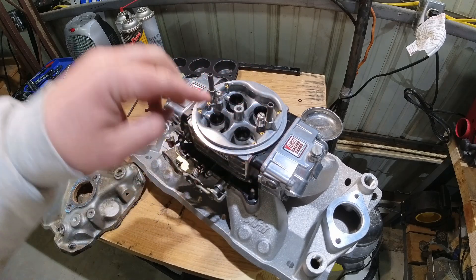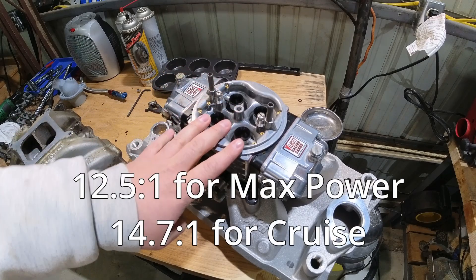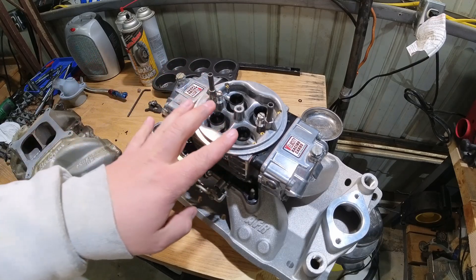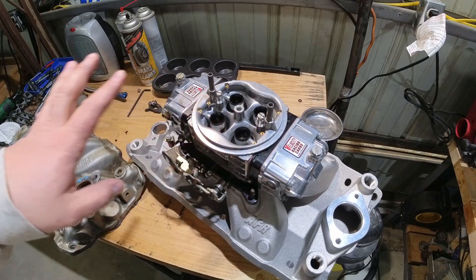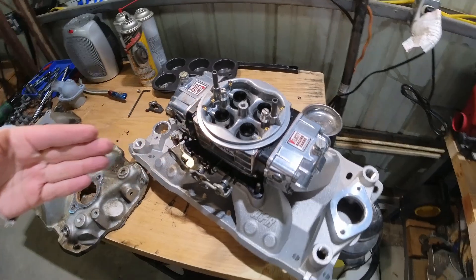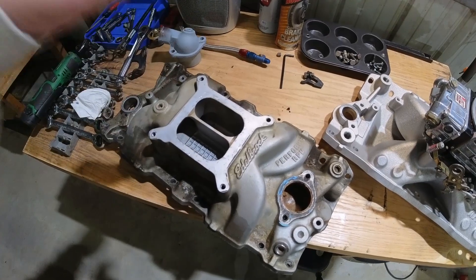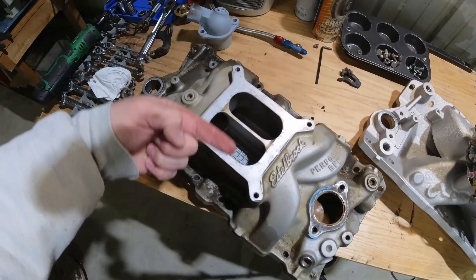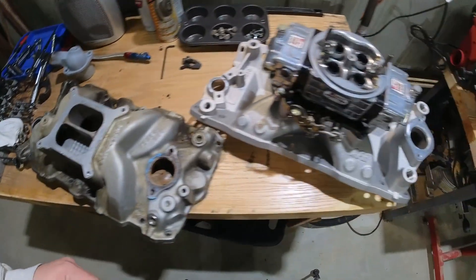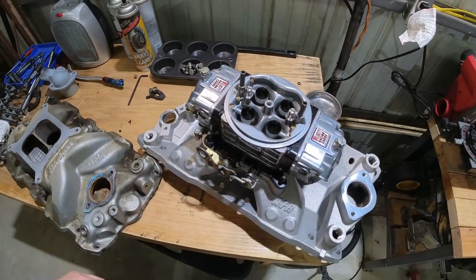When we're talking about making absolute power, it tends to be a richer air-fuel ratio than at a lean cruise like street driving. So the air mixture tends to be heavier than at cruise, and heavier air doesn't like to turn corners. The dual-plane intake manifold has quite a few turns — it flows in, turns 90 degrees in the plenum, comes into the runner, and makes another 90 degrees as it runs into the cylinder head. The single-plane intake has fewer curves, so let's take the carburetor off and talk more about that.